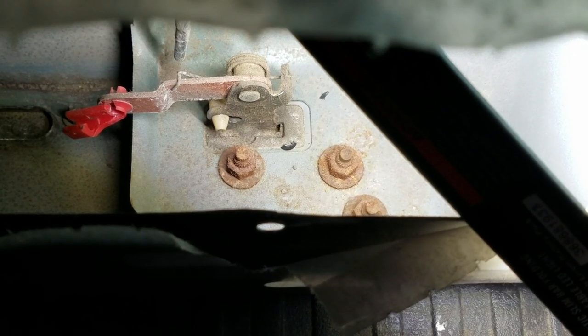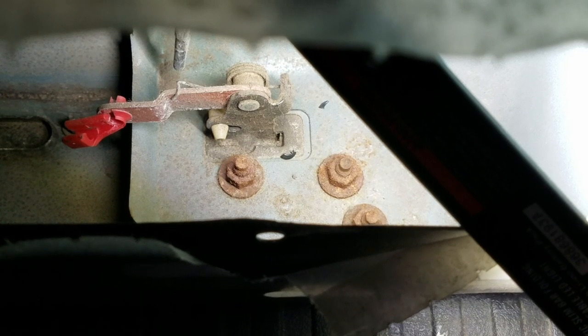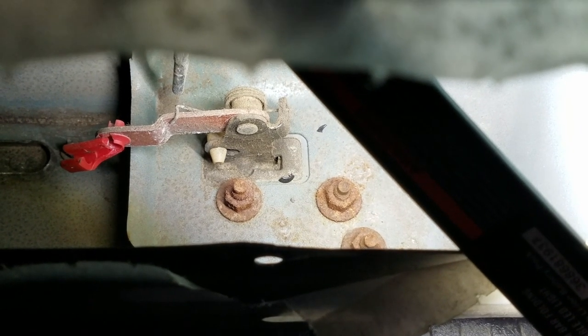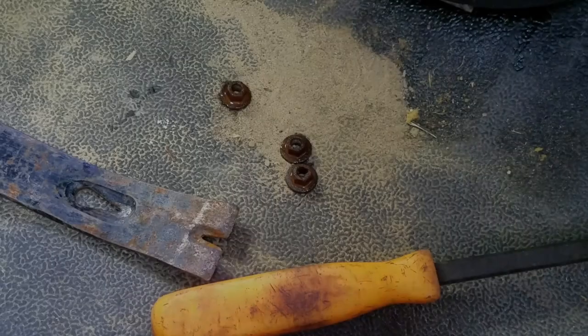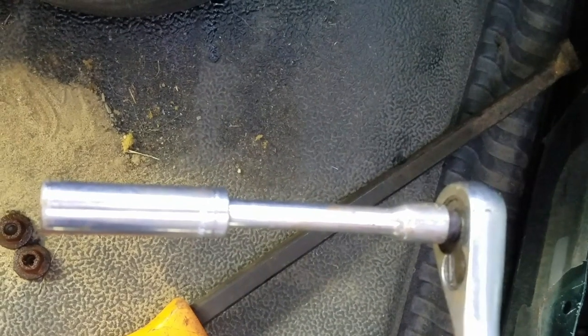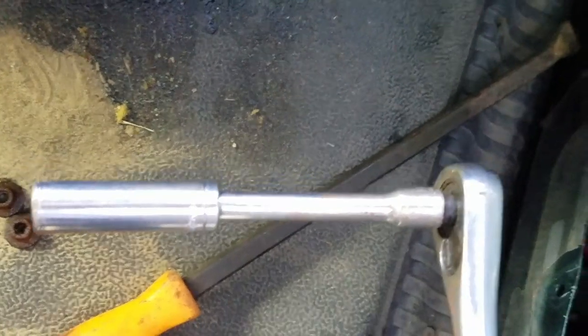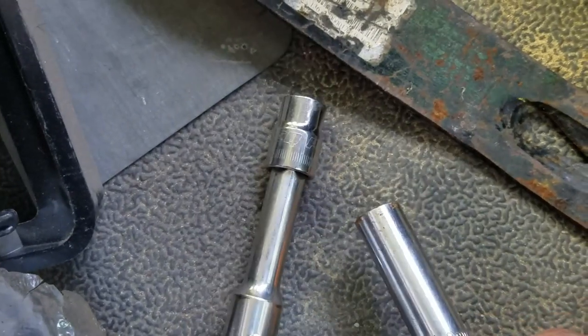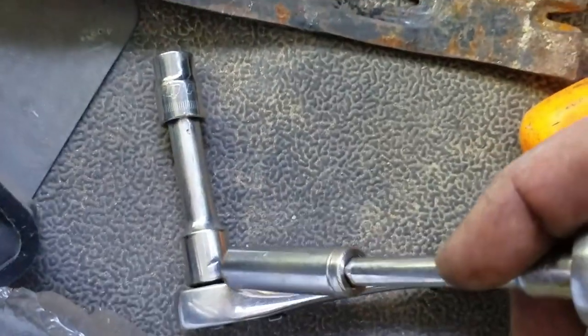Most likely the nuts will break off, so we're going to try with the wrench first. If they come off, great; if not, we'll have to grind them. Hit them with some PB Blaster and let it sit for a little bit, then come back with your 10 millimeter wrench. Those actually come off pretty easy. The best fit for having good room to work is a quarter inch drive with a three inch extension on a deep well socket. With a three-eighths socket, a three inch plus a deep well gets you just right.